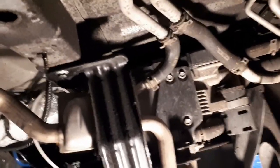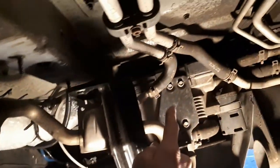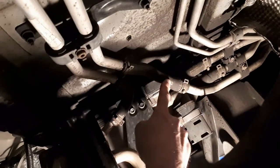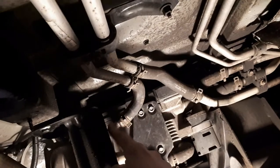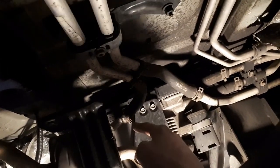What you can see here is the heater fitted by Volkswagen to provide heat to the coolant. You can tell it's a heater because this is its exhaust pipe. That way is the front, looking towards the engine; that way is looking towards the back. Coming from the engine, I've got this pair of pipes here — these are for the aircon. Parallel to it is another pair of pipes — this is coolant from the radiator, part of the radiator water system. So these come out of the coolant heater: this diesel-powered heater warms up the coolant and sends it down these pipes.